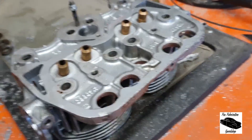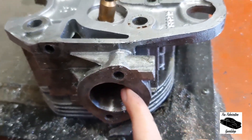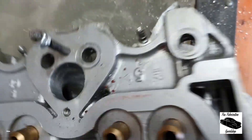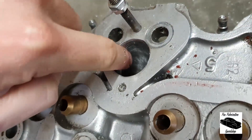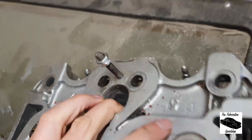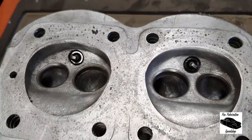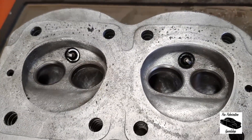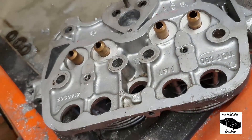Since the last video we've finished the cylinder head work and polished the exhaust manifolds and exhaust ports on both sides. We've enlarged the inlet side to 28mm and smoothed that in — not going mirror polished. We've worked on the inside of the ports and cleaned up the combustion chamber, removed some carbon deposits to eliminate the potential for hot spots and pre-ignition.